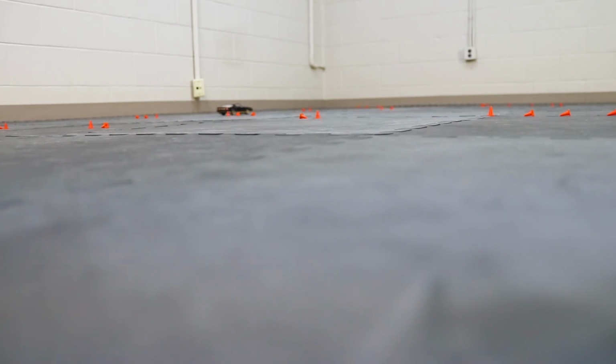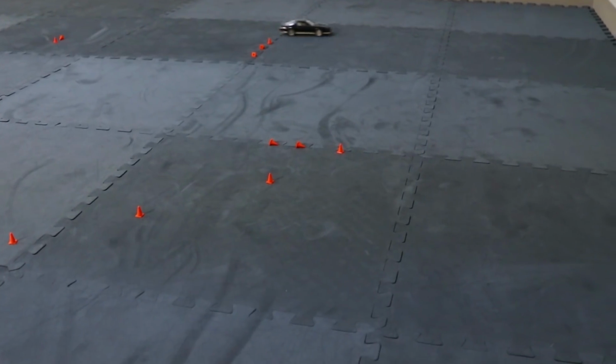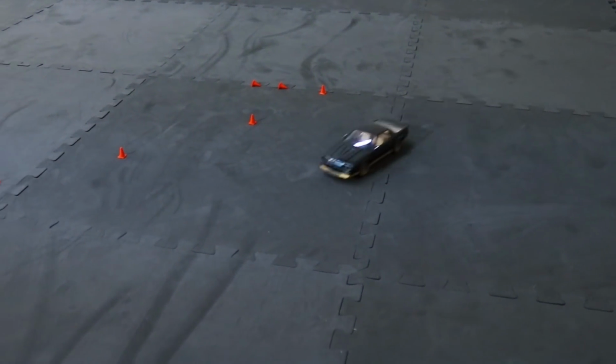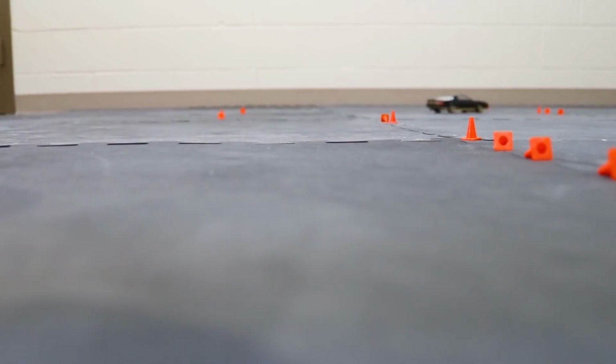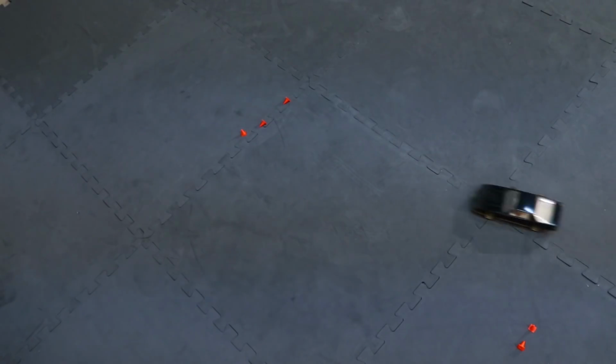The suspension is pretty stiff, especially in the front, because I've dropped the suspension about as low as I can without it being bottomed out. The full-depth interior sitting on the chassis pushes the body relatively high up, so I needed to drop the suspension lower so the ride height doesn't look too high in relation to the body.